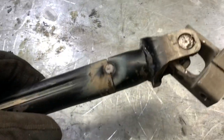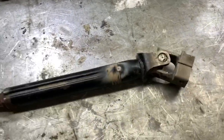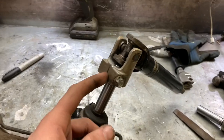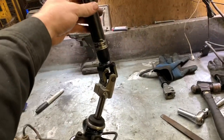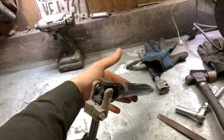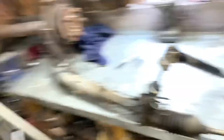I've got a couple pretty good hot tacks put on there. Let's try it and see if we have any binding or steering issues. I had to go trimming a little bit, but got the steering shaft down over the rack, bolted on nice and solid. This is going to be really cool, assuming these three U-joints don't give us any issues. It may seem backwards that I'm doing the steering shaft first before I mount the rack, but I want to have it hooked up to the column just to make sure it doesn't get too close to the brake pedal or hit the floor. Then when I get those adjustments done, I'll mount the rack, because I do have some forward and back room and either way I've got to get longer tie rods.